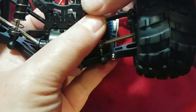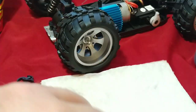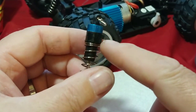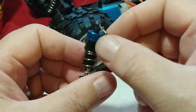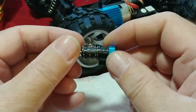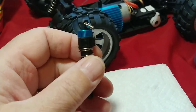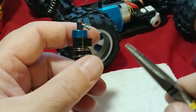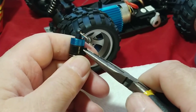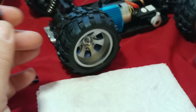With that out of the way, let me show you a little bit more about the shock absorber. Pretty basic design — you have a plastic body, and we have a couple of spacers. These are actually to set the ride height or to stiffen up the rear spring. There are no threads or knurled knob to set preload, so they are using these little spacers. I'm not going to use them because I'm putting oil in here, so I'm removing them with small needle nose pliers and setting them aside.